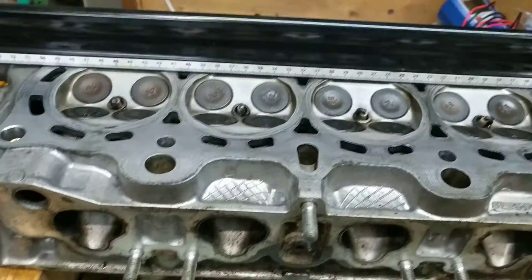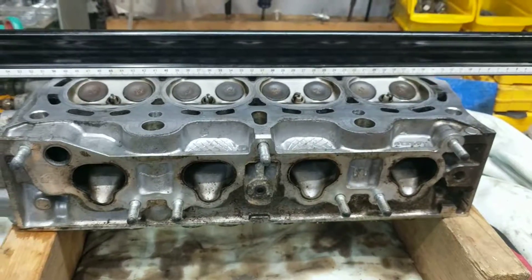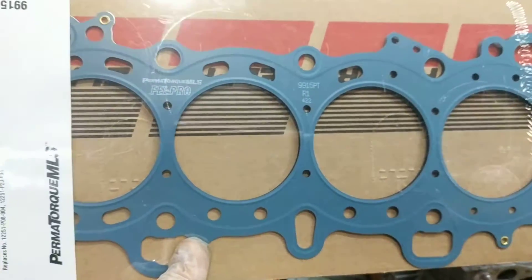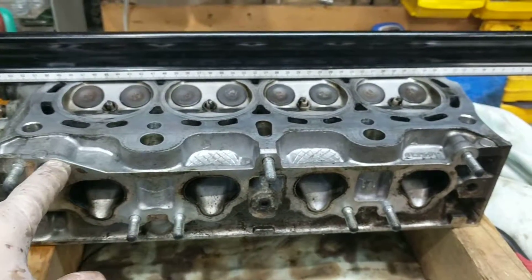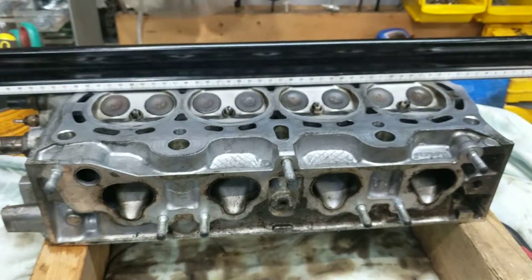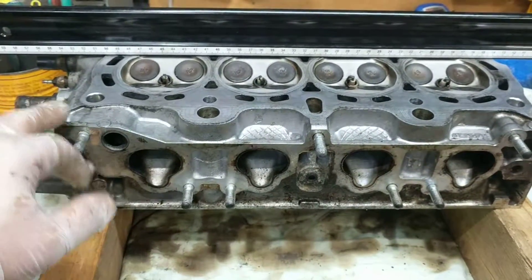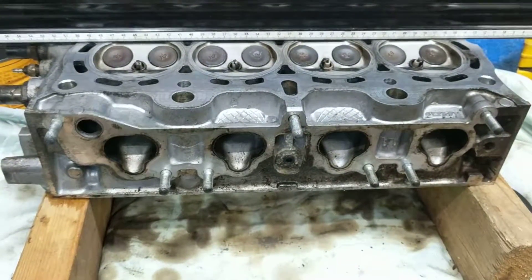The intake gasket — here's the intake side, this is for coolant. I needed a new intake gasket and was going to use the Fel-Pro one, because I'm using the Fel-Pro for the head gasket. But I've seen a lot of warnings about the Fel-Pro one, because there's a little metal ring here on the original Honda one, and Fel-Pro for some reason has the ring in a different location. Their documentation says it's for the EGR and you don't need the metal ring because the whole gasket is metal anyway, but that worries me because a bunch of people said they used it and it leaks. So I'm going to wait for the Honda OEM one that has the metal ring for the coolant line — just something to keep in mind.